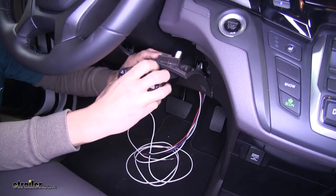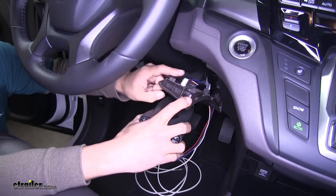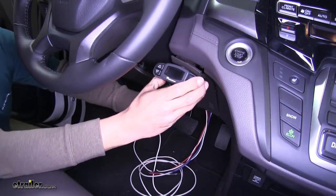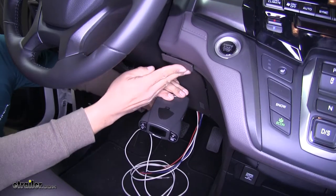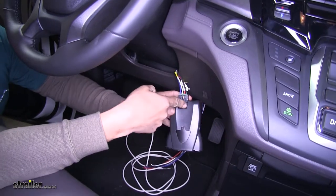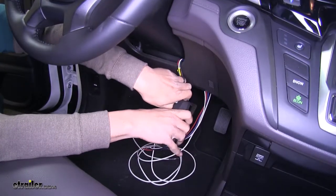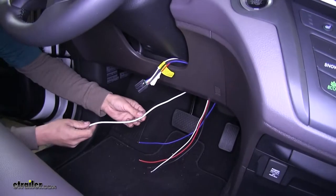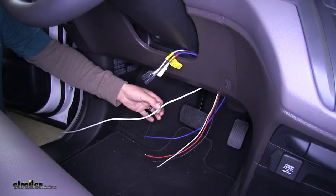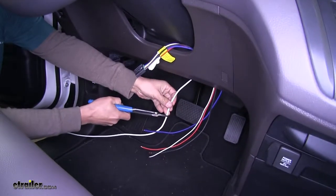You can route your wires around some things — I suggest going towards the middle and staying away from the top section because they do have those clips and you don't want to damage the wires. Once our brake controller is in about the general spot we're going to mount it, clip those clips back into place putting the panel back in. Go ahead and unplug the brake controller — just lift up on that tab and pull the pigtail out. The white wire coming in from our engine bay is going to be connected to that blue wire at the back of our connector, so cut this and strip back the end of our wire. Hold on to that excess wire because we're going to use it in a few minutes.